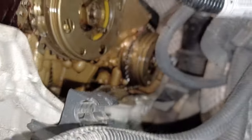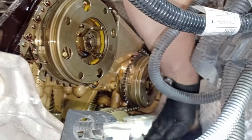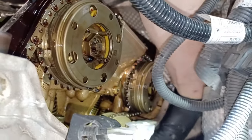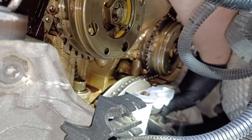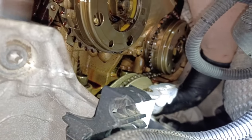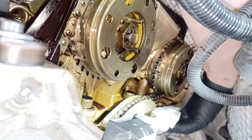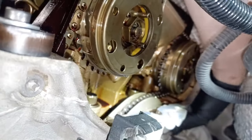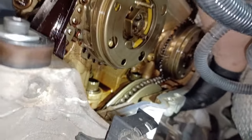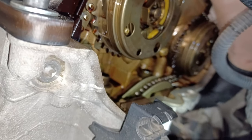Of course, there's going to be a lot of oil, so always have a nice rag handy. Shove it down by the exhaust like that, and you don't have any more cleaning up to do later than what's necessary. Yeah, if it's tight, sometimes when they're older, this is 2018, a bit old, and in slightly seaside, salty conditions, these things are seized in big style usually, awful. Right. Once that's loose, we can pull our lovely sprockets off, finally.